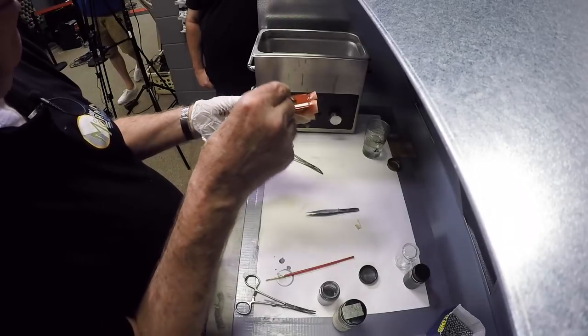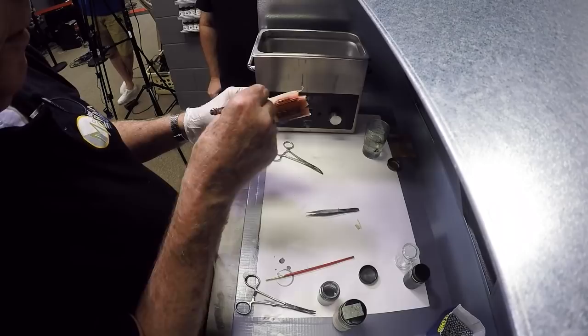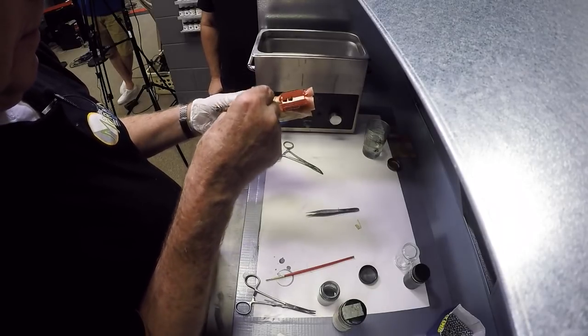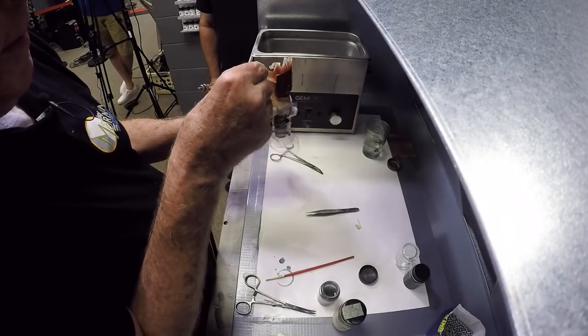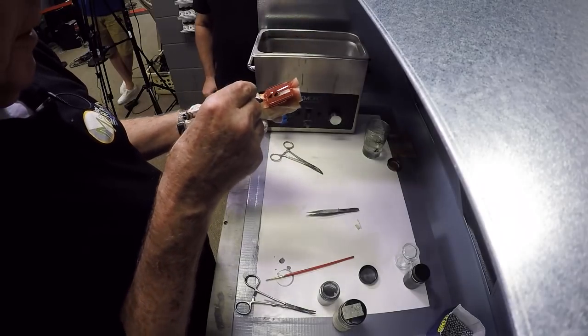And of course, be careful of runs. I don't build it up in one place, or you'll get a paint run. Build it up all over. Get up under there. You could actually touch that up with a brush and never see it.